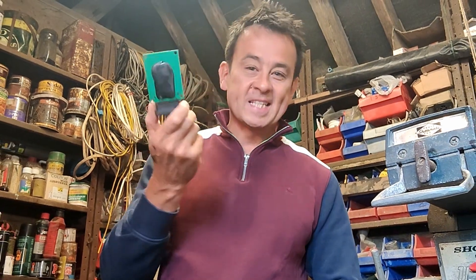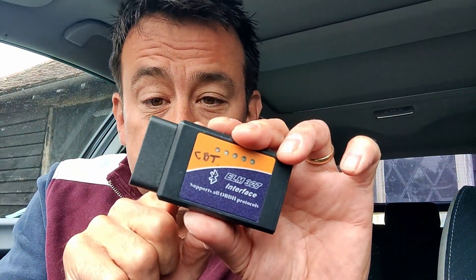The good news is that this is not just a hoax — there is actually some electronics going on. My gut feeling is that they have managed to basically keep the car on the cold startup. When the car is first started, most cars put a little bit more fuel to get the car warm, to get the catalytic converters going, so that it gets to that economical rate — it runs a little bit richer. And I know when I plug in my OBD2, I've got a little cheap one that I keep in the car, and it does bring up a fault on the little code reader, but it doesn't bring up a fault on the dashboard, which is good.